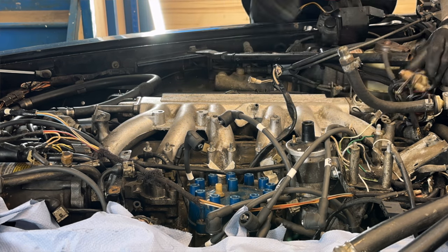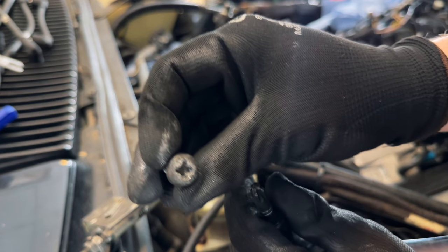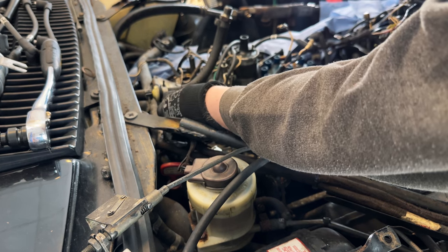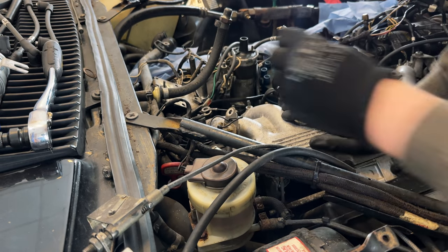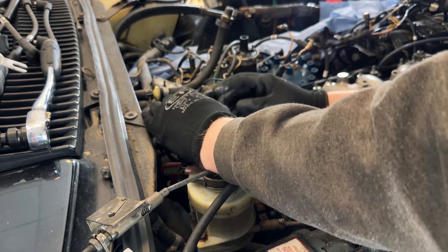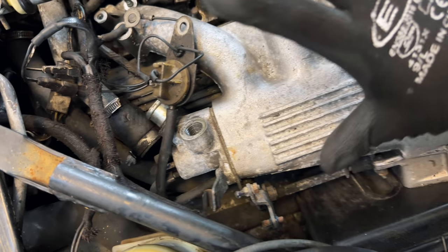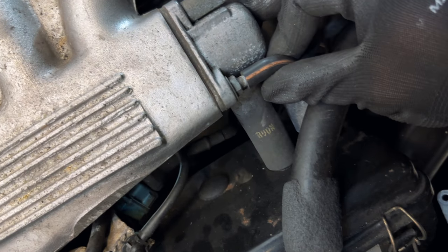So on bank A there's quite a bit to take off. I finally got my PZ4. That is what you need to undo this screw that sits on top of bank A and holds whatever this is in. That then comes away from these two here. I'm going to record everything I'm taking off of bank A because it's quite a bit. There is a little vacuum line that goes onto the back of the bank here and onto the top piece right there. There's also a vacuum line on the back here that needs to come off. That's a 14mm - fits nice and snug.